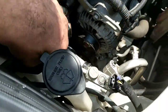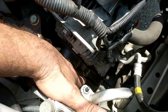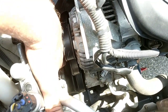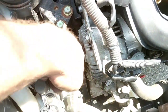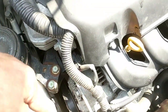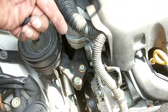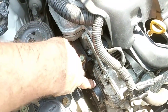So across the bottom: straight from the engine around that one, then it comes up around the three pulleys stacked on top of each other. Then it comes up and inside to that one my hand's on — this one goes on the back side of that one, then comes back up over the top of this one, then goes back down to the engine pulley. There are four total pulleys it needs to go around.